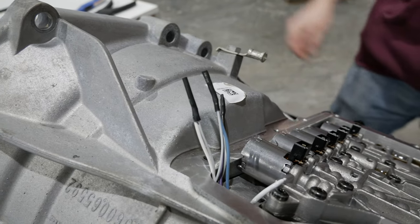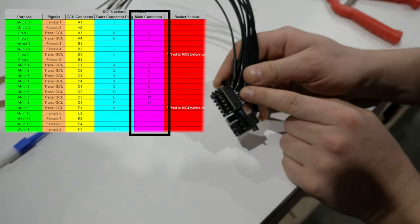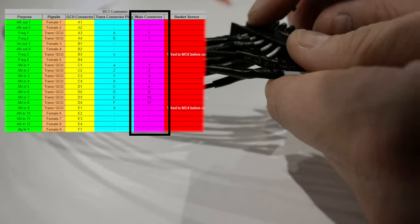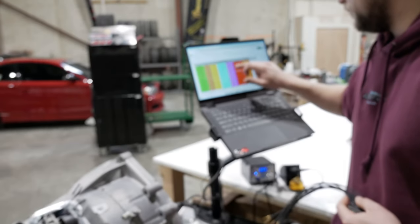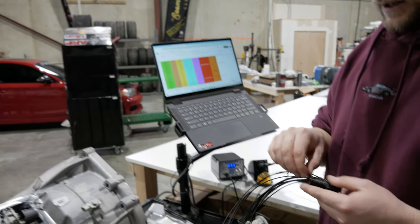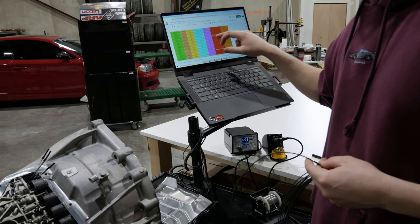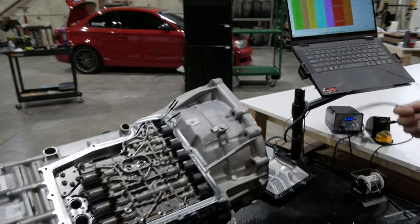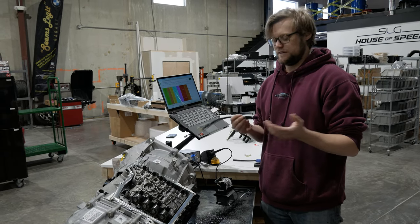Your soldering is done — see, not a big deal at all, just those three wires. Now the next step is to install the main connector. If you look closely here, you can see pin numbers: one, two, three, four, five, and so on all the way down. We're going to look at the main connector sheet — the purple sheet. I like to start at one, which is going to go into lowercase a, and just go down the line and put them in one at a time. Five and seven are uppercase A and uppercase B — please don't get those confused with the lowercase, as they are different sets on the connector. It is much easier to install this without the mechatronics in place, put this to the side, and then do the solenoid wiring last. That's the way we find to be the easiest and what we recommend.